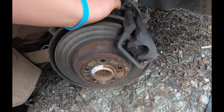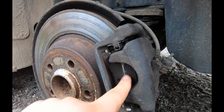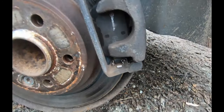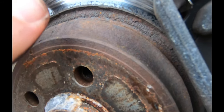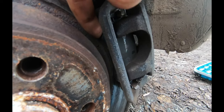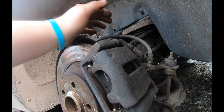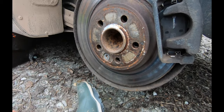Let's have a bit of a pry on it and see what we can do, see if we can separate it and get it working properly. I changed the brake pads here - the rear brake pad looks about right in comparison to the front, carriers are all good. The disc itself looks worse than it is - you can't really feel it at all. Looks like the brake is dragging slightly on the bottom. I think the front issue is that the dust cover is bent up and rubbing on the disc, we'll check that in a minute.